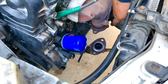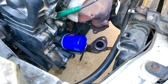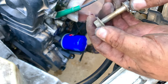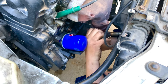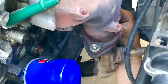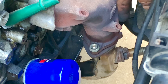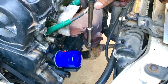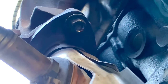We pull the exhaust back into the headers and start putting the bolts in. On the passenger side we're replacing the bolt with a new 12 millimeter one because the old one was about to break. We tighten that 12 millimeter bolt and nut, then go to the other side and tighten the 14 millimeter nut there, which connects the exhaust manifold.